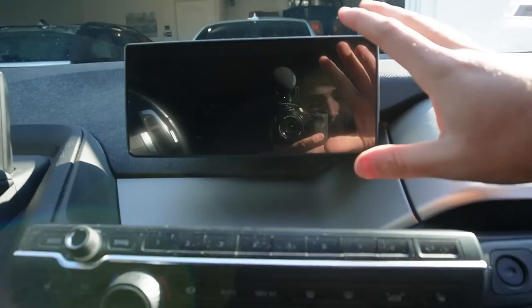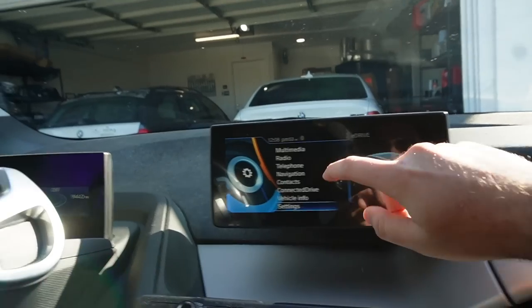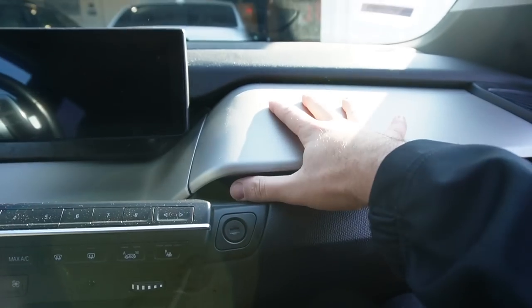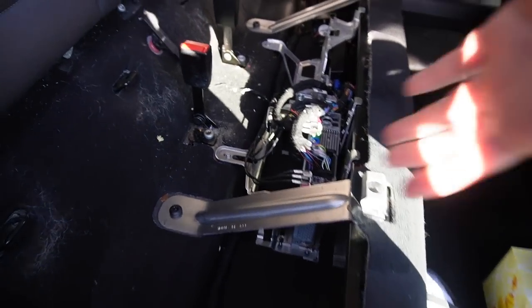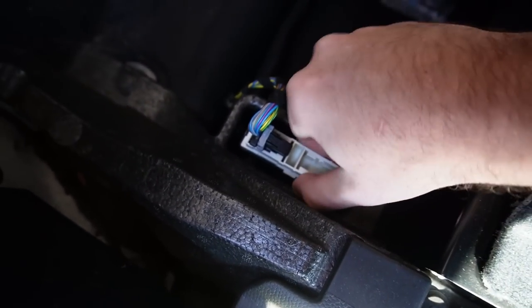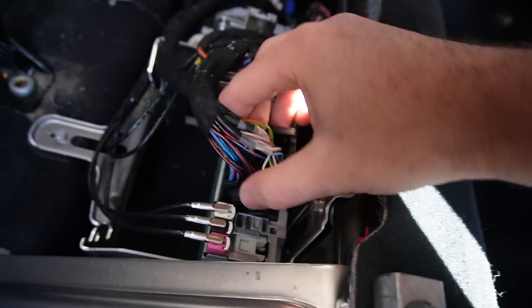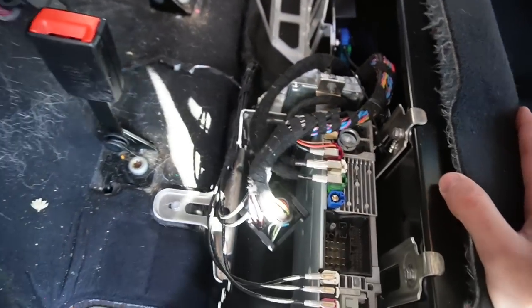My i3 does come with the big screen, which I absolutely love. The only thing it lacks is Apple CarPlay — what are you going to do with it other than listen to music? So without further ado, before touching the kit, let's start taking things apart. We have to take out the glove box and remove a lot of plastic pieces, which will expose all the carbon fiber on this car. We're also removing the rear seats because — let me pull up on this — right there is your head unit. It's kind of crazy that it's actually on the back seat. Since we're back here, we popped up the seat and can see all the modules just chilling back here. The i3 is a quirky car. We're going to disconnect this quad lock and move it out of the way, because we're putting an adapter in the middle of that. That's all we need to do back here.